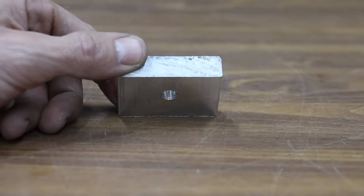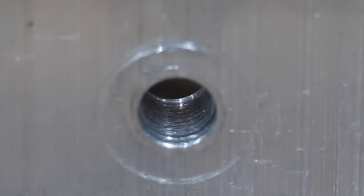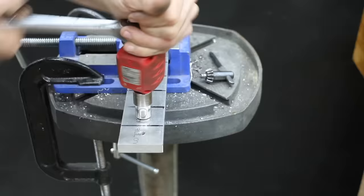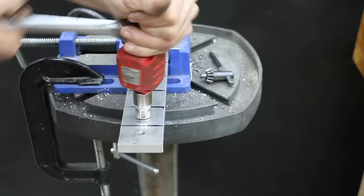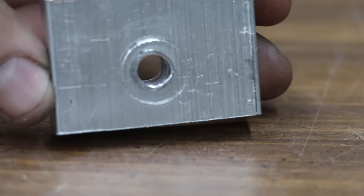All 48 test pieces are properly stripped out. All the test pieces have been cleaned with brake parts cleaner. Obviously, the experience level of viewers varies quite a bit. One question you might ask is, how does a bolt get stripped out? One very common way is what I just demonstrated — by over-tightening a bolt. Another common cause is corrosion. When corrosion forms, just removing the bolt can cause a lot of damage to the threads. Cross-threading a bolt occurs when the threads of the bolt are not properly aligned with the threads on the workpiece, causing a lot of damage.